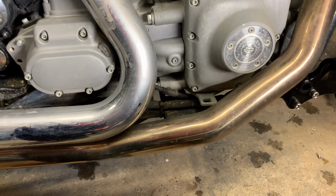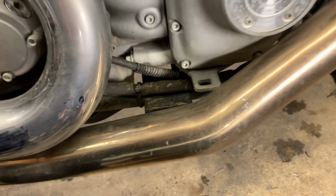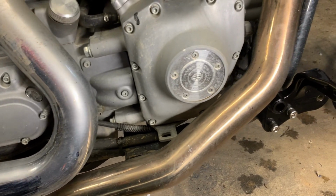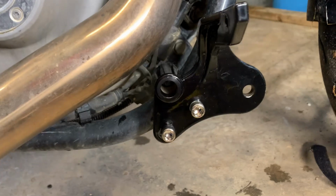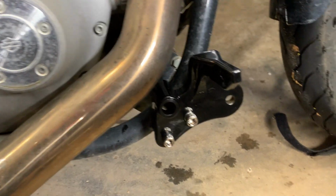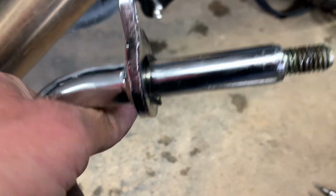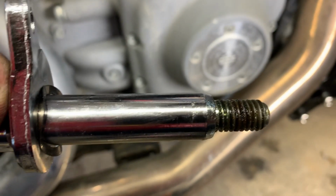We have all the brake side removed. Had to remove the brake rod, pedal assembly, all of that. Crash bar had to come off. We've got this bracket on here. Those were torque specs 25 to 30 foot-pounds. I hit 30. And you have this brake rod here, wave washer on it. Got to do anti-seize, which I keep a container of with me.